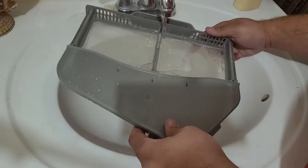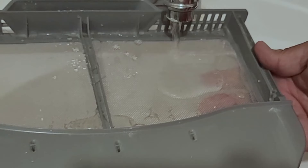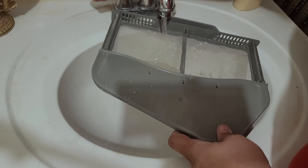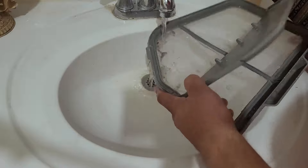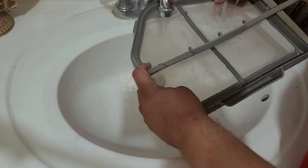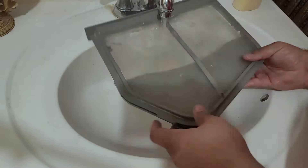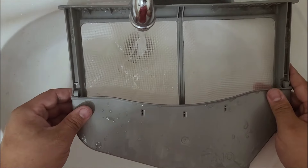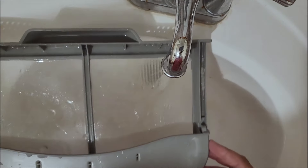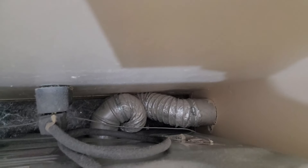Let's take a look at how hot water runs on this filter, as it's a very important point. You'll notice first that there's some pooling on the filter — water is not draining straight through. This is a visual representation of what happens to your dryer's airflow: just as water pools, it means air is not venting efficiently or effectively, despite the fact this filter looks visually clean. Now watch as we speed up the hot water — you can see the difference. It flows much differently now and the water goes straight through easily. This is how it should always be.